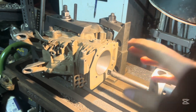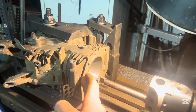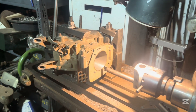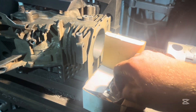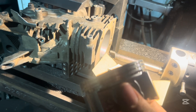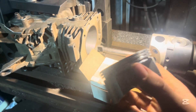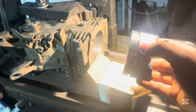Dad has helped me set this up, so this is all ready to go. This is like a test block — we're kind of in the mix because we don't know if the deck's going to be right for the piston height. We'll cross that bridge when we get to it. This is just a test to see if it's going to be okay. I bought two new 72mm pistons ages ago, probably in September of last year. This is a flat dish, sort of a hot rod design. So what we have to do is measure this piston, then bore that out to pretty much the exact same size, and then take the rest out with the cylinder hone.